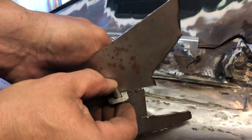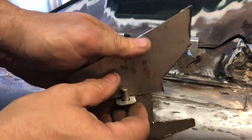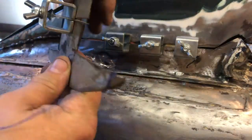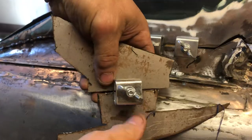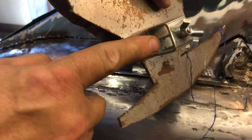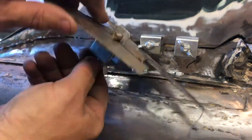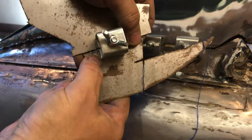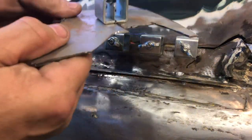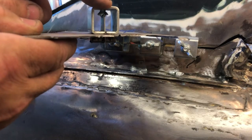I tell you what, if this works first time, round of applause, please, because I haven't even practiced it. Right, there we go. You just tighten it on. Obviously what you're seeing on the other side is this. As you tighten that, it draws this blade in and pulls the peg tight on the other side. So you end up with two sheets of metal, and they should be level, because the bottom of this square keeps them level.